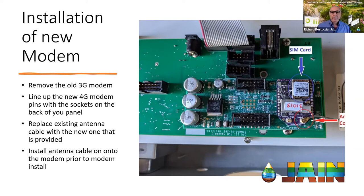So it should come off — it's not going to fall off by itself, but with little pressure from me, it's going to come right off. No tool necessary. Once the old 3G modem is removed and disconnected, we're able to put the new 4G modem in. As mentioned, it is a pin and socket style setup. You'll need to make sure all of the posts are lined up with the sockets so we don't bend any of them or get it in wrong. Once you get it lined up, with a little bit of pushing — you should be able to push it in with just your thumbs.